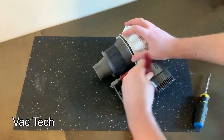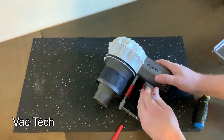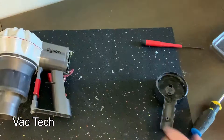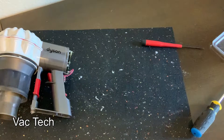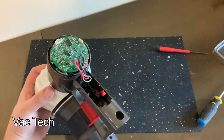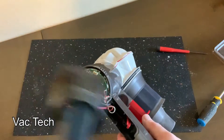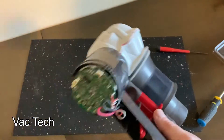I had to pry from the bottom after the battery was out. Once the clip was unclipped at the bottom, I could just pull it off and unsnap it from the vacuum. It's hard to see in there, but that's a little sponge filter and it's filthy. All that discoloration was dirt and it reeked of pets, so I had to wash it — and it made all the difference on this base model. Once I had the filter cover off, I could see the circuit board and it was dusty. So I very gently cleaned it off using a soft dusting brush, being extra careful to get all the hair and dust off without causing damage.